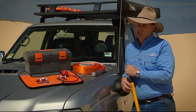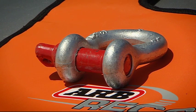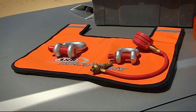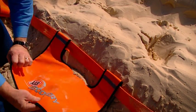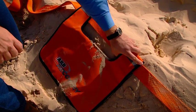If you carry one of these, we also like you to have a couple of rated bow shackles. These things won't break under load, so they're the safest way to go. The next thing we like to take is your cable dampener. You pop this in the middle of your snatch strap so if anything does break, it keeps everything nice and low to the ground because the cable dampener pretty much acts like a bit of a weight.